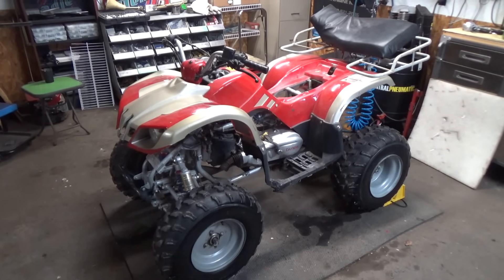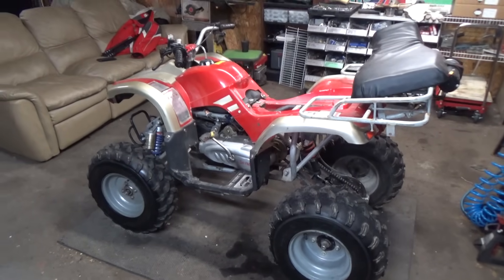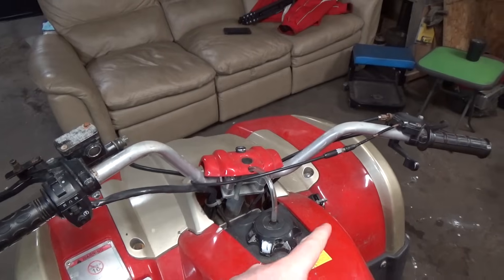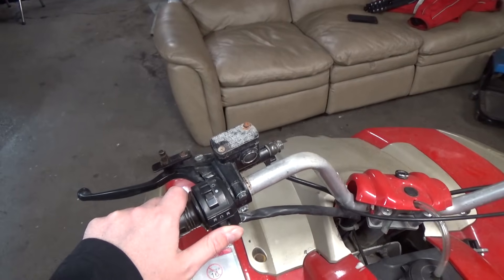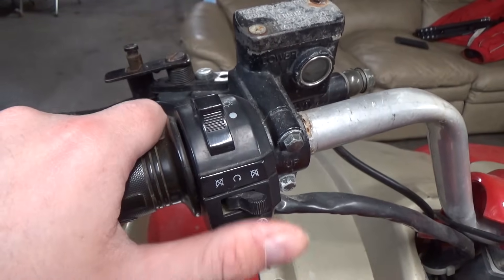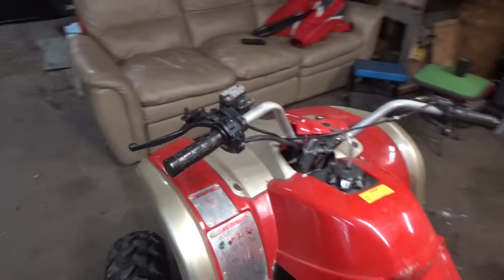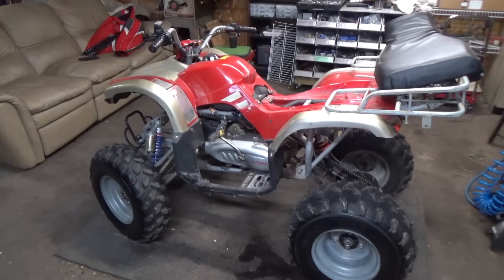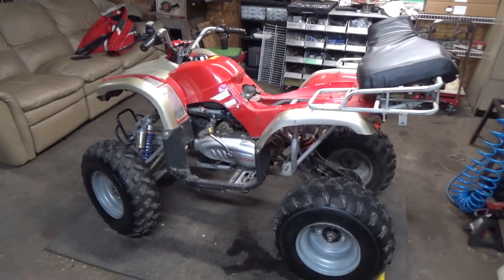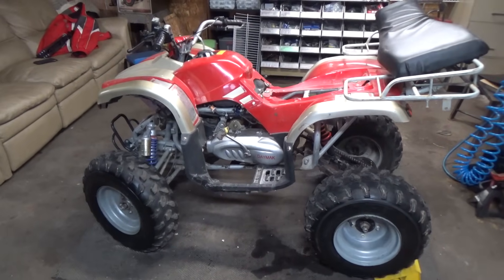To do that, I hooked up my battery booster because he had a 12 volt battery in there that was completely dead. I put 12 volts to this thing, put the parking brake on because you have to engage the parking brake — it has a safety switch on it. With the ignition on and the kill switch in the middle run position, I pushed the button and nothing happened. I know that the push button start works, and we had 12 volts at the battery — over 12 volts when I tested it with a multimeter. So that led me to believe that it was a solenoid issue.